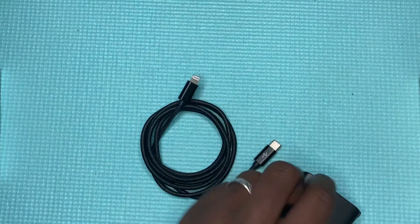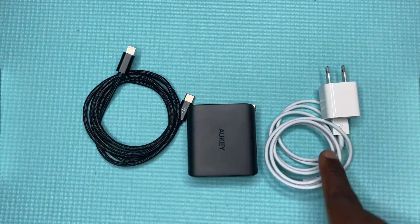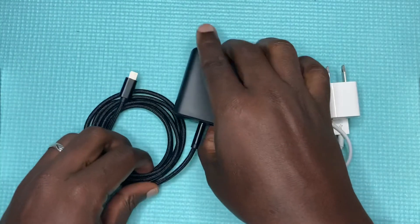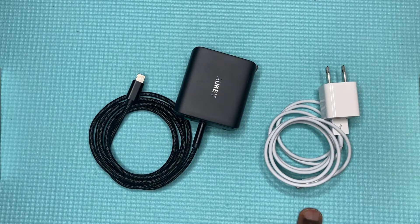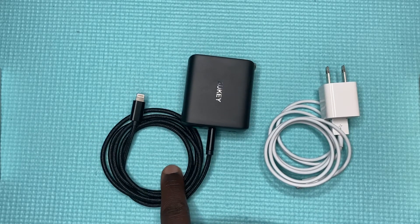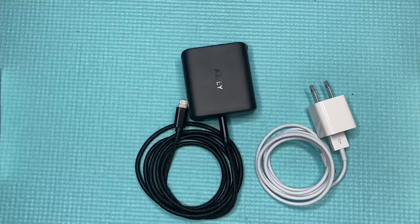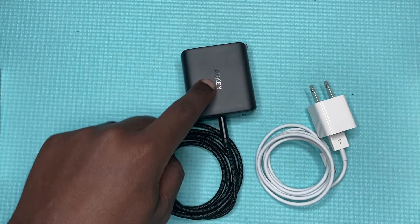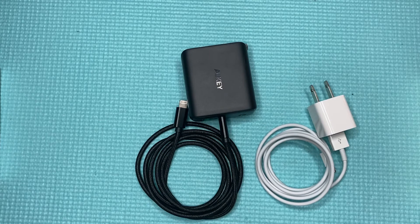So those are the two types of cables: the fast charging USB-C cable and the slower charging USB-A cable. As opposed to 5 watts with the default charging brick, you get 18 watts with the fast charging setup. If you want to go fast charging, I definitely recommend you buy a USB-C to Lightning cable and a compatible fast charging brick with USB-C.